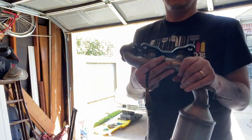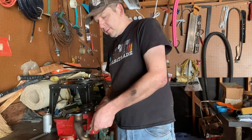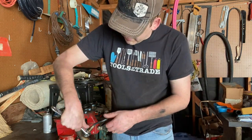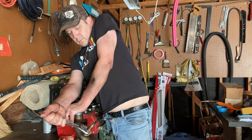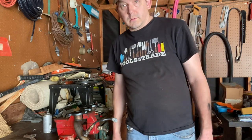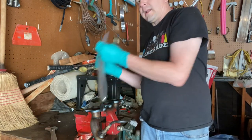The new cat does not come with any brackets to mount the heat shield, so when we put this back on we won't be reinstalling the heat shield. Now I'm putting the original O2 sensor into the new catalytic converter. You can put a little bit of anti-seize compound on the threads — I used a crescent wrench to get them off and it worked well. I had replaced them in the past with anti-seize on the threads, which helps out for anyone who has to change them next time. Don't forget to remove the old gasket from the exhaust — the new catalytic converter comes with a new one.